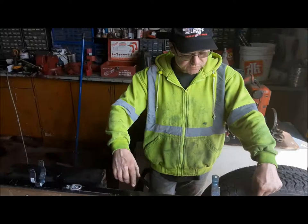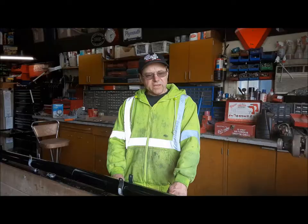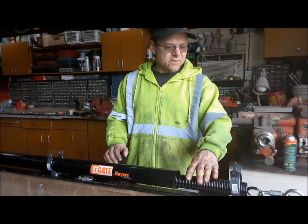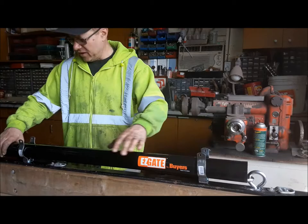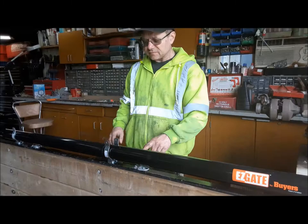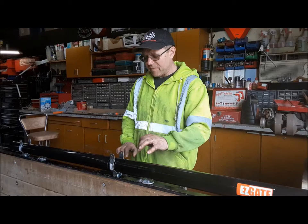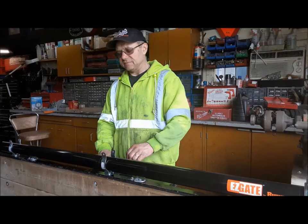I managed to incorporate this corner tie-down into this hook. Now we're going to mount the eye bolt here that's the anchor for the tension spring. But before I do that, I've got to get the spare tire off and out of the way because it's blocking where I have to go. We're sliding the tubes now over the spring. Unfortunately, right here underneath this rail is a post, so I was unable to bridge that gap. I'm going to see what it's like once I get everything tightened up and determine if we have to come up with some kind of secondary means of securing this.